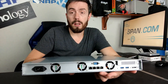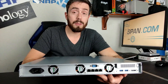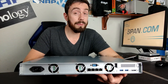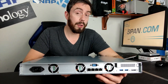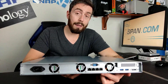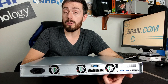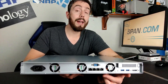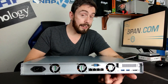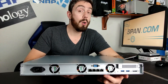Moving to the middle, we can see four LAN ports. This device supports link aggregation, which means that with a LAG-supported switch or port-trunk-supporting switch, you can go up to four gigabit Ethernet connectivity between you and this device. Link aggregation in a business is most useful when connecting all four LAN ports to a single switch that supports it, ensuring all connected users get the maximum amount of bandwidth. If you only used one LAN port with four different users accessing it, they would all share that single gigabit connection.